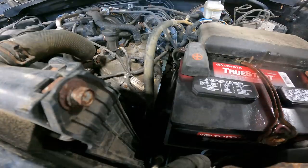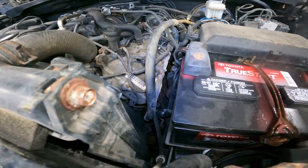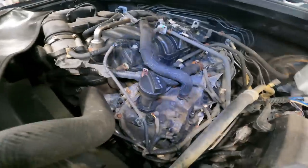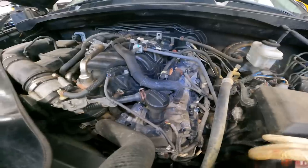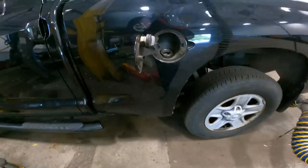We're going to do an initial start of the vehicle. What we're going to hear is a very high idle — let's get it started. Right now we're idling at about 1,300 to 1,400 RPMs. We're going to let the vehicle warm up and see how low it drops. If it doesn't drop low enough, we'll perform a throttle body relearn. We may road test it — ideally we want the idle between 750 and 850 RPMs.